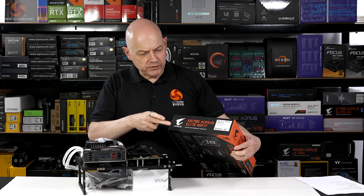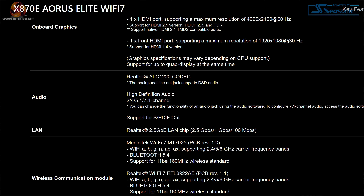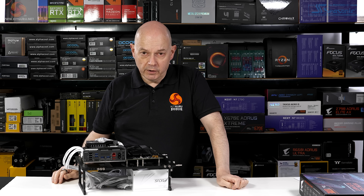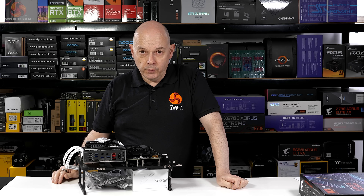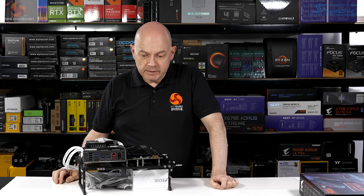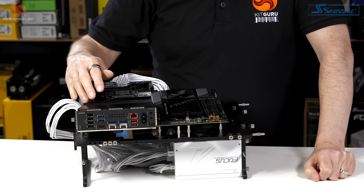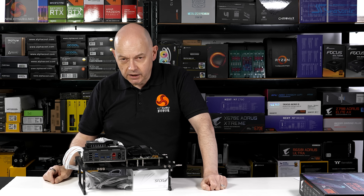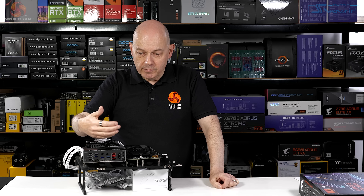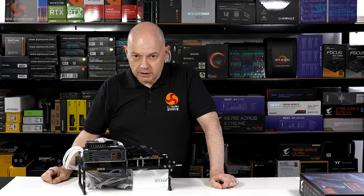This is version 1.0 of the motherboard; Gigabyte lists a version 1.1 which appears to change from MediaTek to Realtek Wi-Fi. The MediaTek hardware had no problems whatsoever — it was very nice. Whether the Realtek is better or more reliable, or whether they're dual-sourcing, is unclear. A feature worth noting is the ventilated rear I/O panel, which allows air from the heatsinks to escape to the outside, aiding cooling rather than damming hot air. There's no active cooler — just a little bit of ventilation.